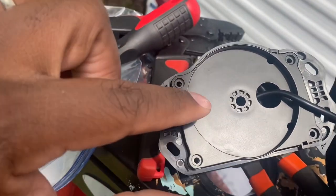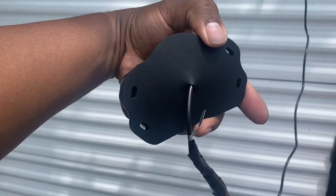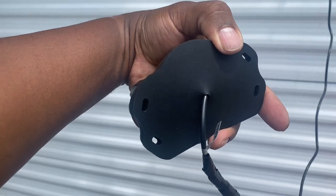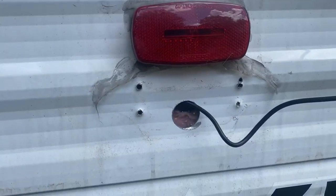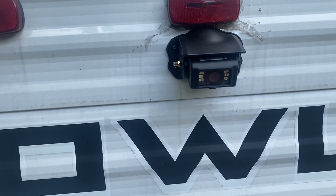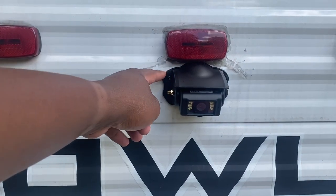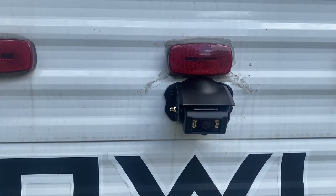Once you've stowed the wiring, this is the first back piece that you have to put on. You just put in the four small screws. This is the rubber gasket that comes on the back — you have to put that on and then you screw this on. This should create a watertight seal, but you still want to use caulk. You have to fit all of the wire back into the hole. Don't forget to try to remove as much of the old caulk as you can — use whatever you have, a razor blade would do. This is the camera installed on the back of the RV. Now we're going to do some caulking. I did have to make new screw holes, so I'm going to caulk to keep the water out and double secure it.